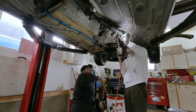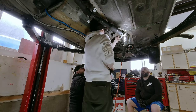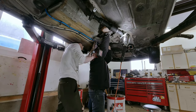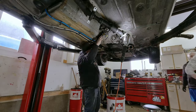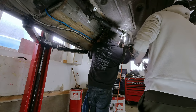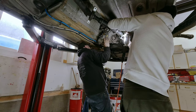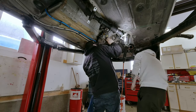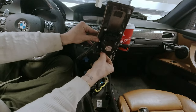After the transmission fluid is drained you can start removing the rear brace on the back of the transmission. Once we lowered it, it didn't move too far - the bell housing rested on the subframe. If you don't want that, put a jack underneath the transmission to keep it in place. Disconnect the oil level sensor - it's way in front in the harness itself.